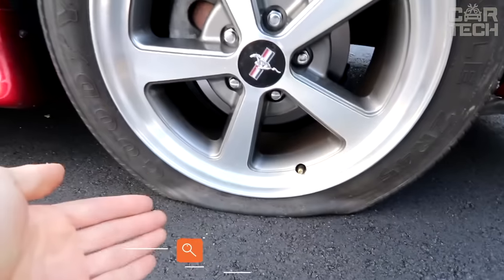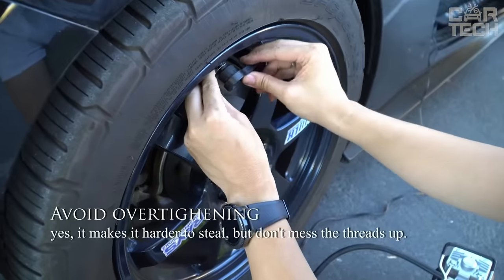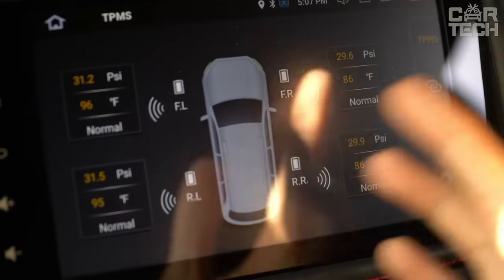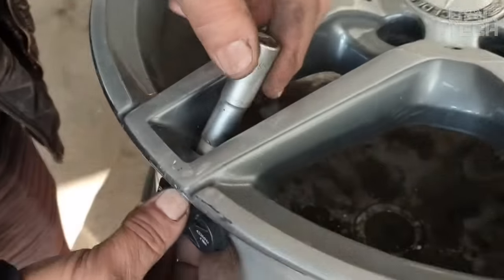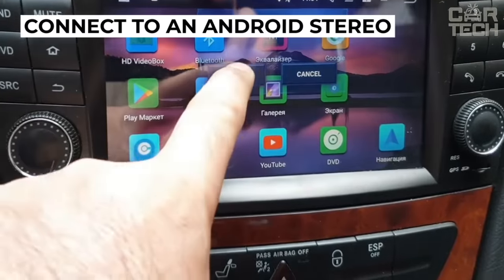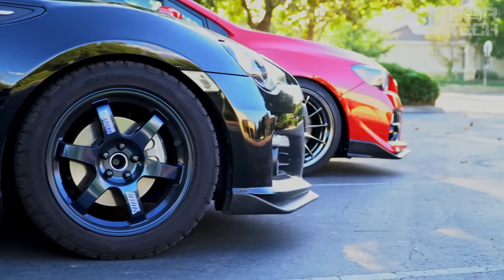There is not even much to say about the importance of proper tire pressure in your vehicle. If the tire is underinflated, it will worsen braking distance, increase rolling resistance, and lead to increased fuel consumption. On the contrary, if the pressure is higher than normal, it can have a detrimental effect on the chassis parts and accelerate the wear of the tire itself. Tire pressure monitoring helps you set the correct pressure in all four tires and monitor it in real time. There are two types of sensors available: internal and external. External sensors are not recommended if you leave your car in an unfavorable neighborhood. The advantage of this system is the ability to connect to an Android stereo. The sensors detect pressure from 0 up to 8 bar and also show the temperature of the tire, with readings displayed on the screen.